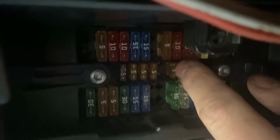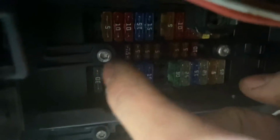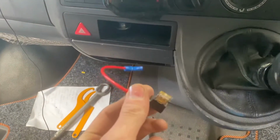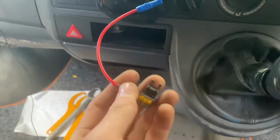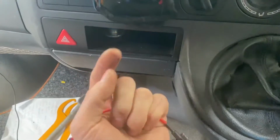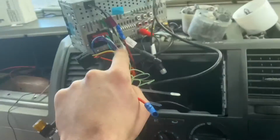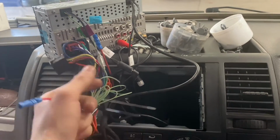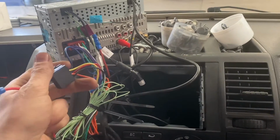just where my finger is here. I know it's a bit dark. That's actually on the S contact switch. So I'm going to put an inline fuse holder, which I had kicking around, so it has a spare junction fuse on it, and then run a feed wire that goes all the way up to the back and then goes into the wiring, which would be the ignition switch of the actual harness here. Just keep following.